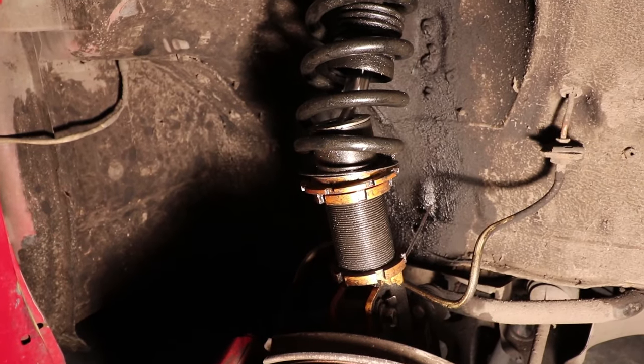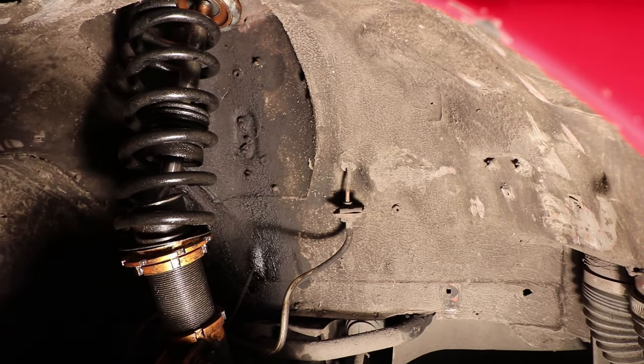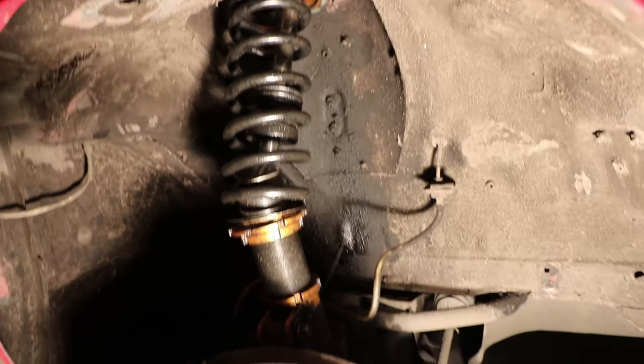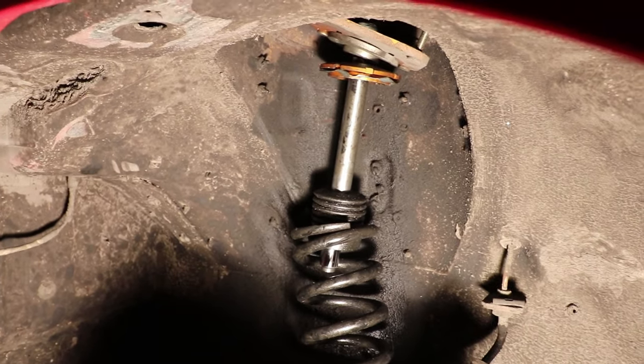With the wheel off you can see, on closer inspection, it's all dried with dirt there and then suddenly it's wet all the way back. I think all the fluid from that just pissed itself out. Taking all the bolts off, the bottom part of the coilover pretty much just fell off the top part.